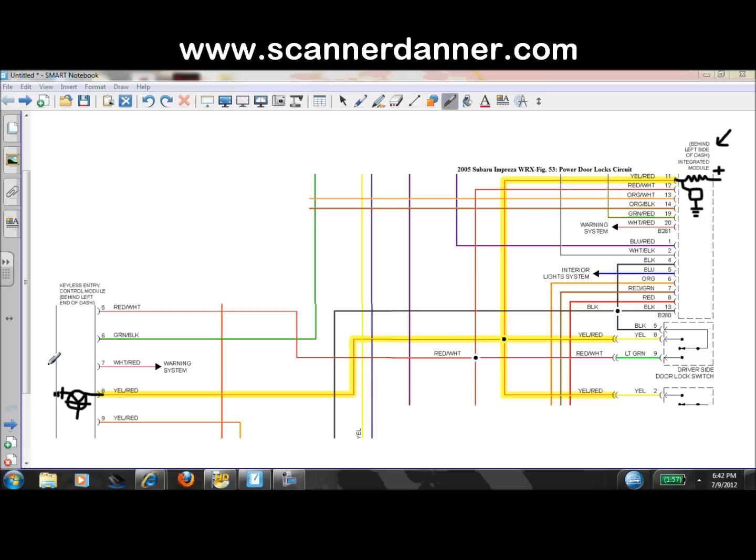But what I did is I drew a transistor inside of here, and I'm pretty sure that this is the way this works, so just bear with me for a second. We discussed pull up, pull down circuitry, and you can see that my integrated module over here is the one that does all the controlling. I mentioned in the previous clip that all the door lock motors are reverse DC electric motors, and they're controlled by this integrated module. I also believe the sensing circuit is part of this module, and I described it as a 12-volt pull-down design.